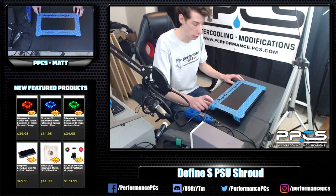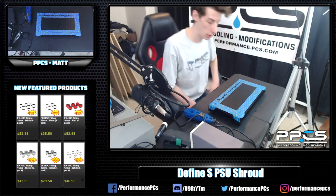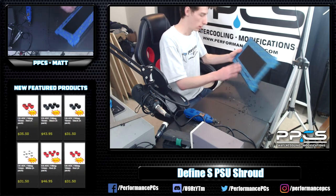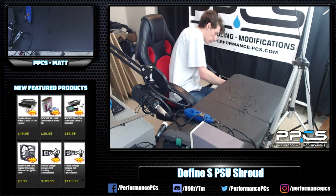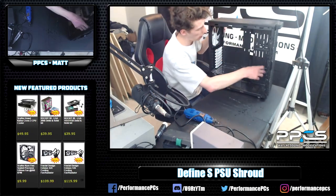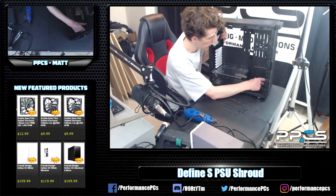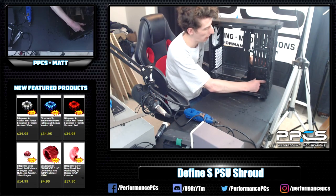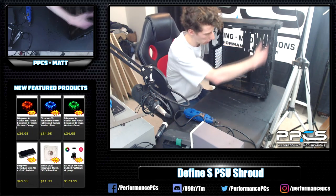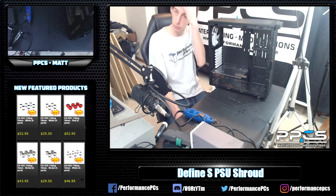After I get this all cut out I'll just drill a couple holes in the corners — I plan on having four standoffs and that should work for the front panel, which should be arriving today. So let's see — Thursday, same time, 12 p.m. stream, we can start putting that on there. As for the other mods, the plan is to make a reservoir wall — just a square reservoir right here made out of five mil acrylic. I've got an idea on how to mount it. I'll cut out where these lines start, the reservoir sits mostly in the back, so if you mount a radiator up here you won't run into clearance issues. Give me any tips if you've made custom reservoirs because I haven't, and we'll see if I can make something that doesn't leak.